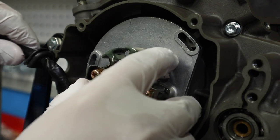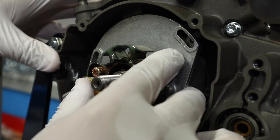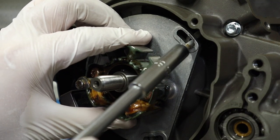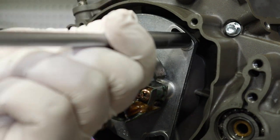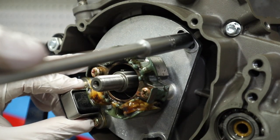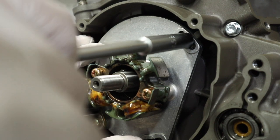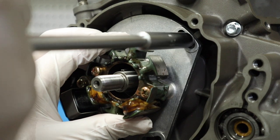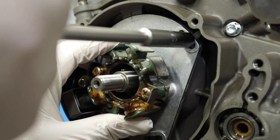I'm going to loop this around, get it into place, and insert my little grommet on the left for my wiring. More than likely you'll have indentations on the stator plate where your screws are — those are good reference points, but ultimately you want to just set your timing to factory if you don't know any different. You don't want to torque these really tight — at most seven or eight foot-pounds — and that'll keep you from stripping the cases.